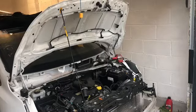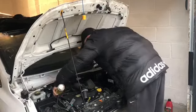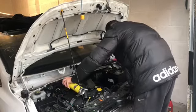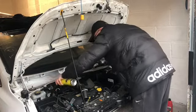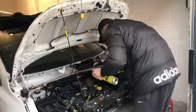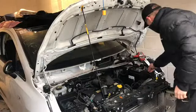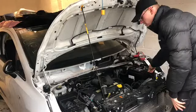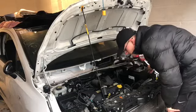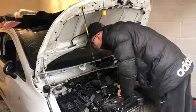That's not working, so I'm going to get some brake cleaner — I'll put it down the throttle body intake. Make sure it only goes in there because it's highly flammable. Something isn't quite right, but the engine does run briefly when I do that.